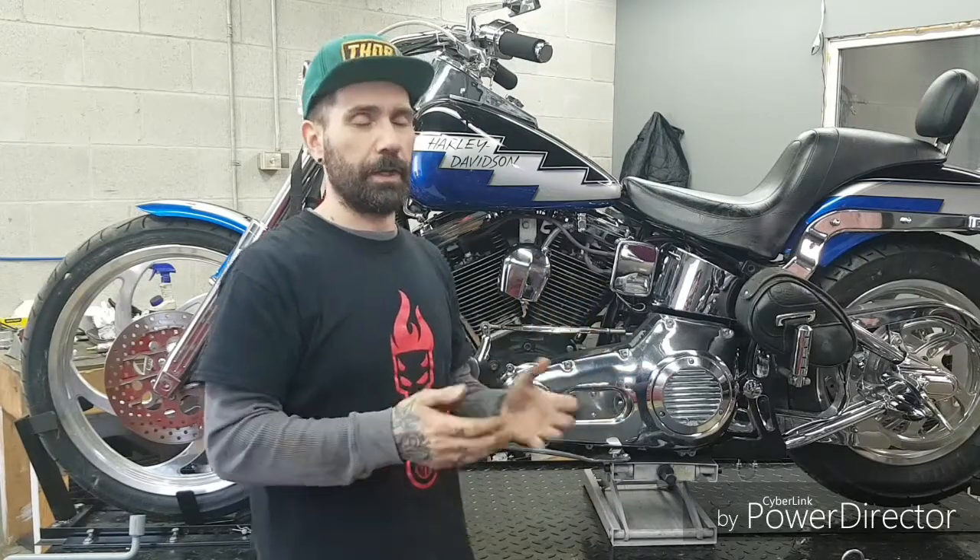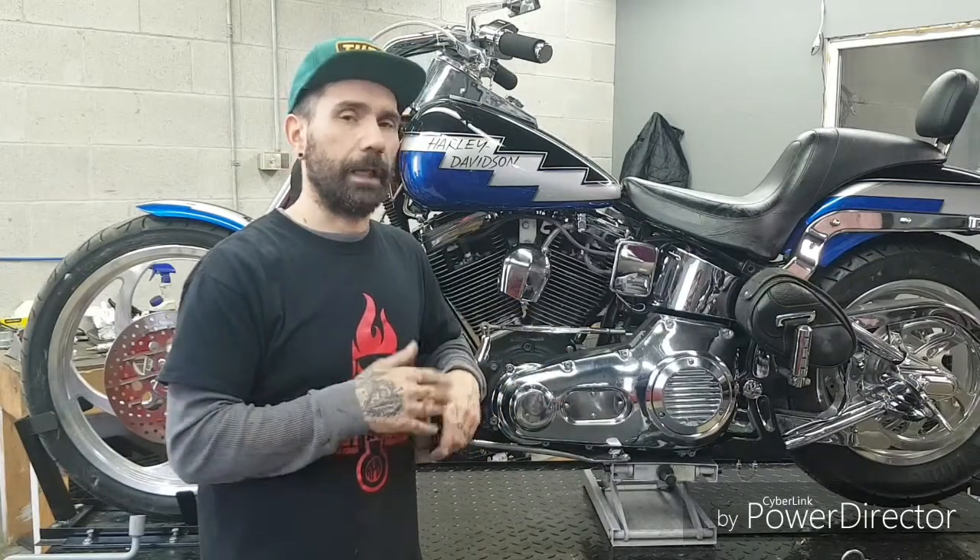Usually if we're checking the charging system there's a reason — possibly the battery itself isn't in great condition. With a good OEM-type YUASA battery, we used to get five to seven years with a properly maintained and charged battery. I think quality has come down a bit, so you're looking at maybe four or five years with a good OEM-style YUASA battery. Some of the less expensive batteries you might only get a year, but I work in that three to four year range depending on how well the battery's been maintained under regular operating conditions — that's the life expectancy of a quality OEM YUASA battery versus a white-box or economical less expensive battery.